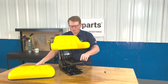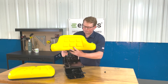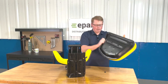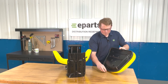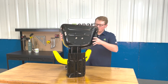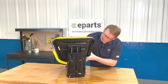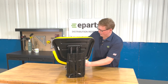On the bottom side of the seat suspension, you'll see that there are also four slotted holes there. On the bottom cushion, you want to take four of the bolts and just start them on the bottom side. From there, you'll be able to hold the seat up to those slotted holes, lock it in place, and then tighten those right there on the bottom side of the seat.